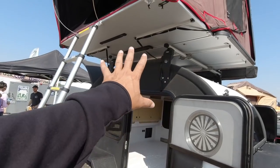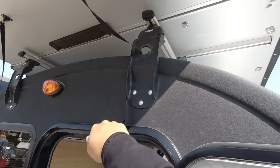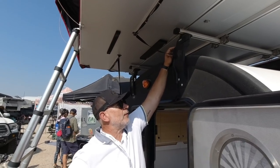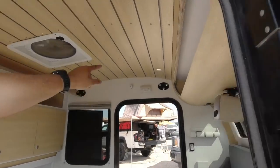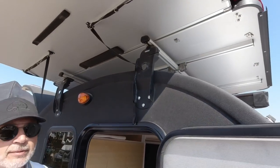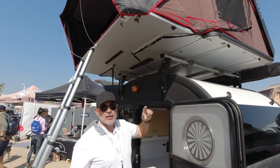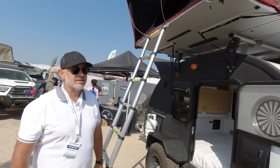The roof rack brackets are custom made by Bean Trailer and are actually through-bolted into the cabin, so they're incredibly strong. The brackets end at a platform and then whatever your favorite rack system begins from there. As for weight capacity, the weakest point is actually the crossbars — for this setup it's rated at 220 pounds.